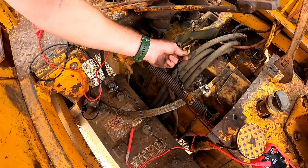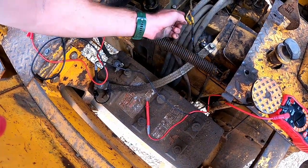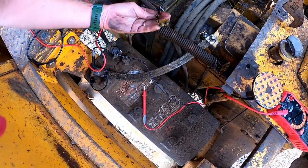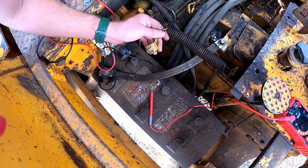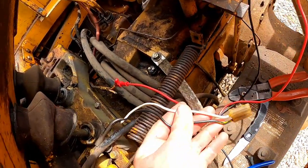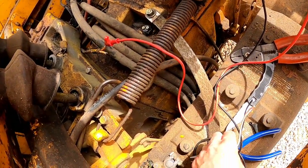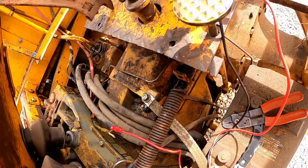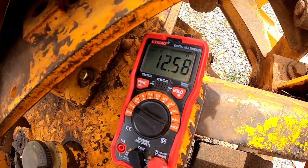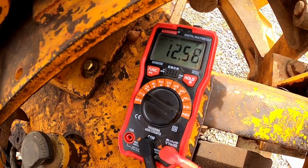So now I have some wiring to look at. I just pulled this out, and I think the first thing I should do is check these crimp connectors and take back this electrical tape that someone put on here to see what's behind it. I took off that crimp connector, went ahead and hooked up directly to the wire, and now I have 12 volts on the one side. So that should take care of my problem.